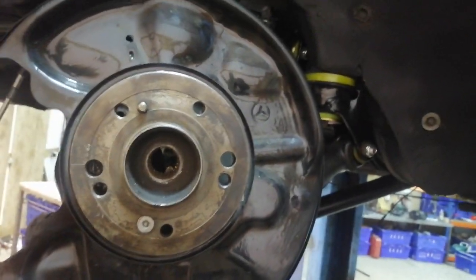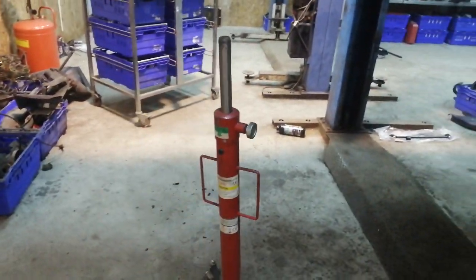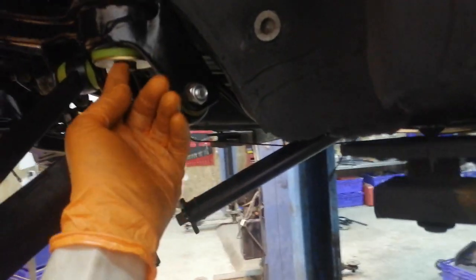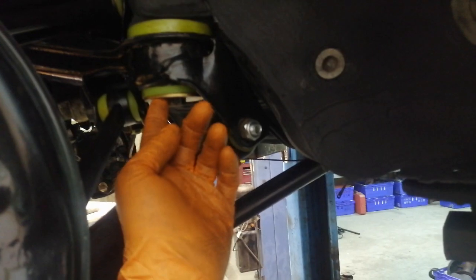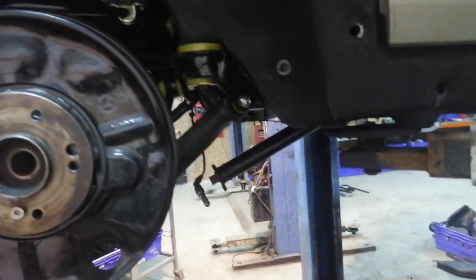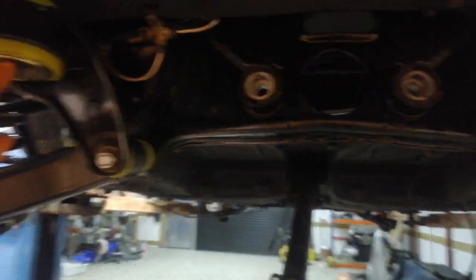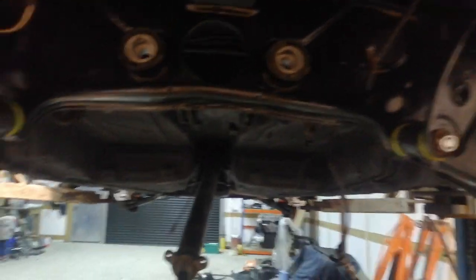But when that was there, I could let off a little bit of pressure, not an awful lot, because you don't want a whole lot of the weight hanging off these, but a little bit of the pressure, and then I was able to maneuver it. And I was lucky I had the option to use one of them. Basically, I put the washer sitting there and the bolt, and I actually sent it up with the transmission jack. And once it sat up nice and high, I was able to then screw the bolt in, let off that side, and then move to the opposite edge, the one out here, and basically did that in diagonal as well.